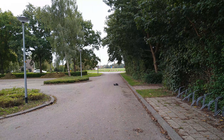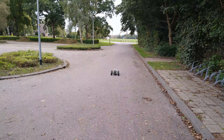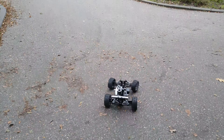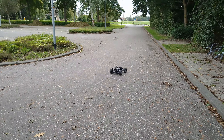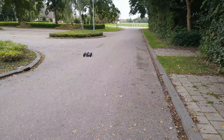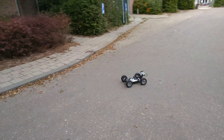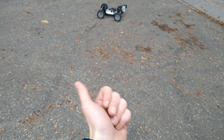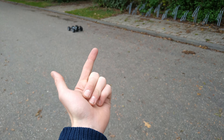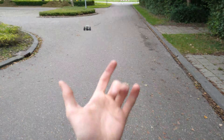Alright people, so we're doing the first — well, this is the fifth tank technically. We're doing a quarter throttle for a whole tank. I've done it before on Nitro Brother Dave's Force 38. Basically we're running around like this for a couple of laps, a couple of tanks. Maybe just one tank: one tank quarter throttle, half throttle, three quarters throttle, then full throttle, then it's done. Maybe a second tank of full throttle just for extra safety.